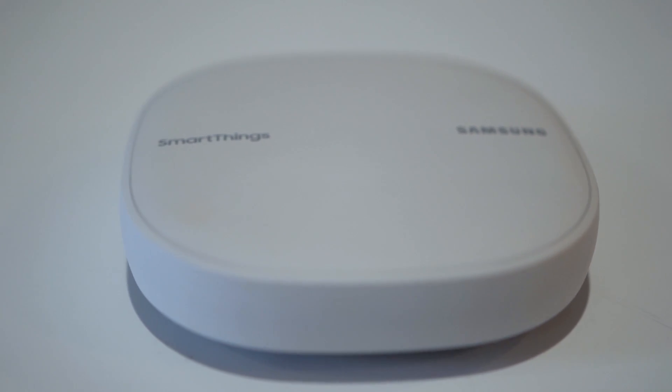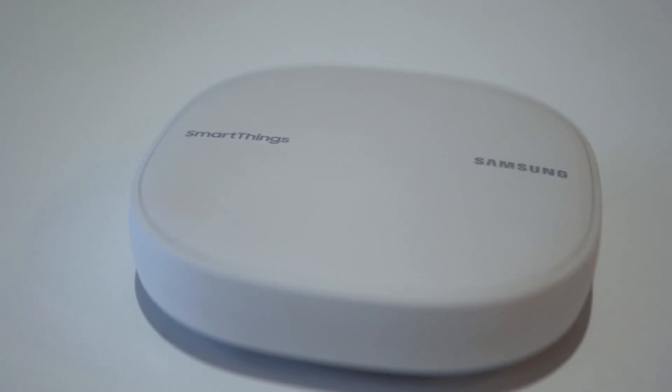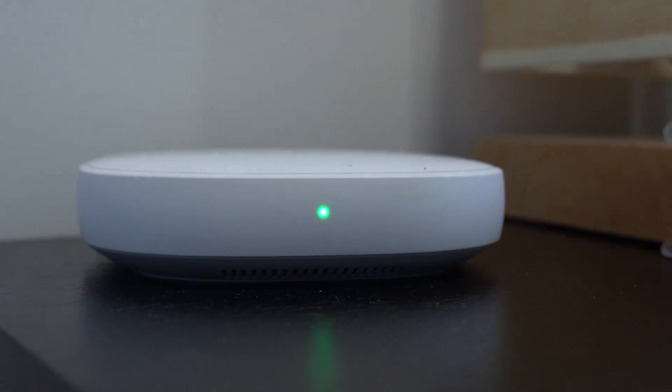The most popular benefit of these mesh Wi-Fi networks is, of course, better range. The satellite systems don't need anything besides being plugged into a power outlet, so there are a lot of options on where you can put them. You can put these all over your house and cover it all in super satisfying strong Wi-Fi signals. And even in a smaller space like my apartment, you can use it to further your 5 GHz coverage, which has a much faster throughput but a much shorter range than your 2.4 GHz.